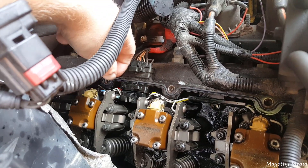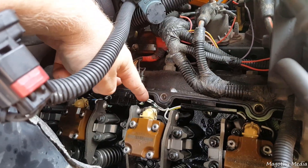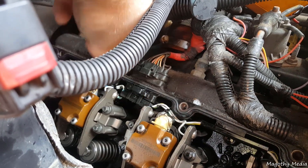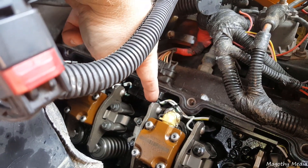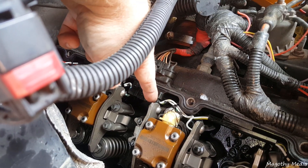The clips are supposed to snap in tight, but even if the wires push on the corner, you can see that connector starting to come loose again. What will happen is you build up high resistance when those connections struggle to make a connection.